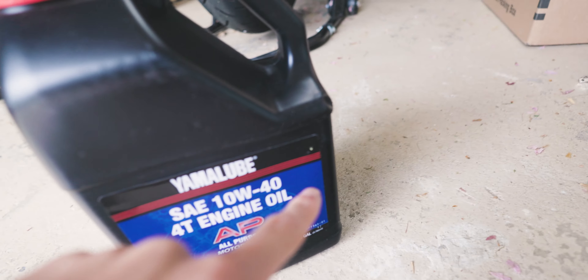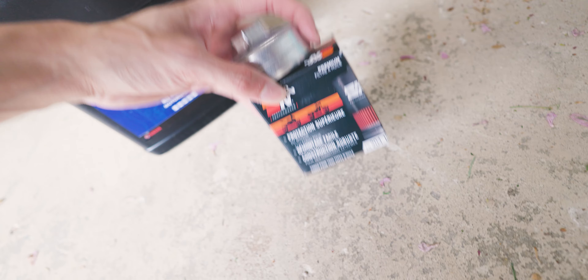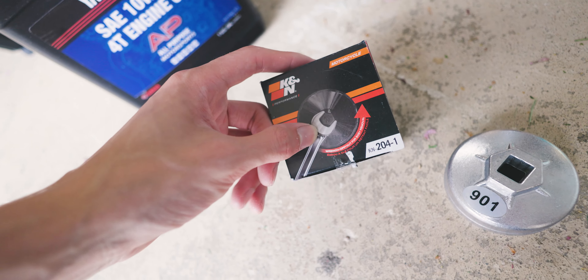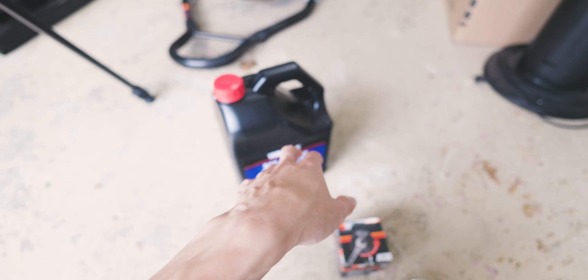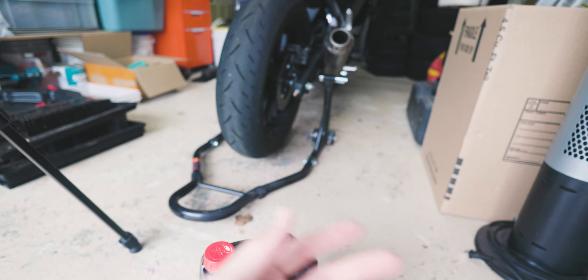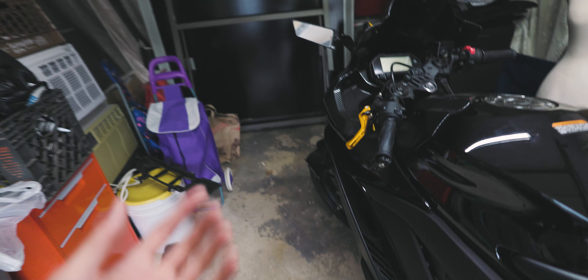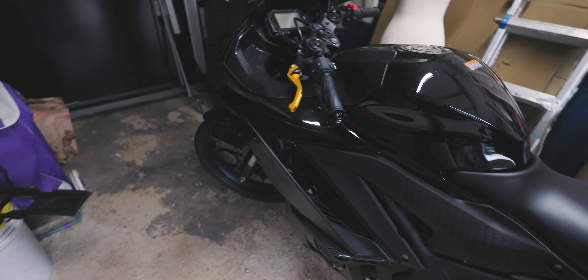Let me show you what you need for this process. First, you're going to need your oil — this is Yamalube 10W40. Then we need the oil filter; I got this from K&N, their performance filter. We also have a wrench piece for the oil filter to remove the OEM. The thing about this aftermarket oil filter is that you don't need a wrench — it already has the adapter piece — but you need the wrench for the OEM because it doesn't have the little nut on it. I do suggest getting a new drain bolt, but the Yamaha dealership told me that for the break-in period you don't need a new drain bolt or crush washer, and suggested changing that out every other oil change. We're going to change the oil filter first, then drain the oil and pour in the new oil.